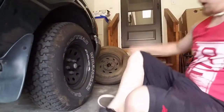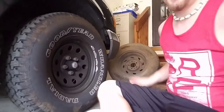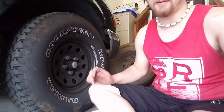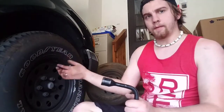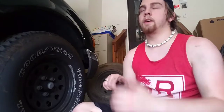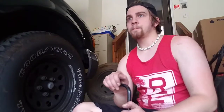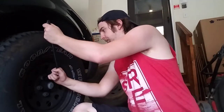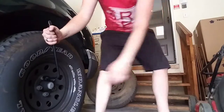Once you get your spare out, what you're going to want to do is take your lug wrench and loosen the lug nuts before you lift it up. I'm demonstrating on my front tire, but any of your tires can blow. You want to loosen these before you jack it up, because once it's off the ground — especially since I have a rear-wheel drive — these aren't engaged to anything, so they're just going to spin freely. If you have front-wheel drive they'll still be engaged in the transmission. You usually have to stand up to do this because they're on pretty tight — counter-clockwise, lefty loosey.